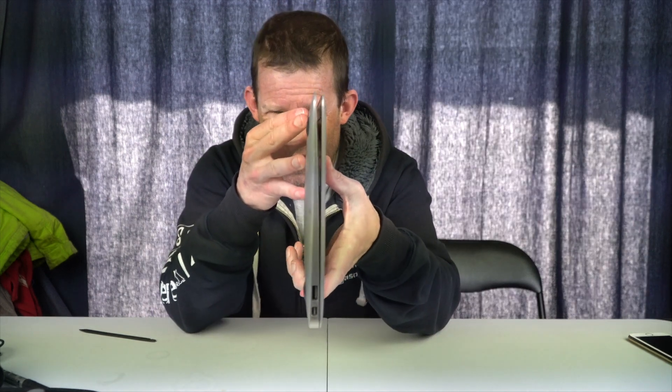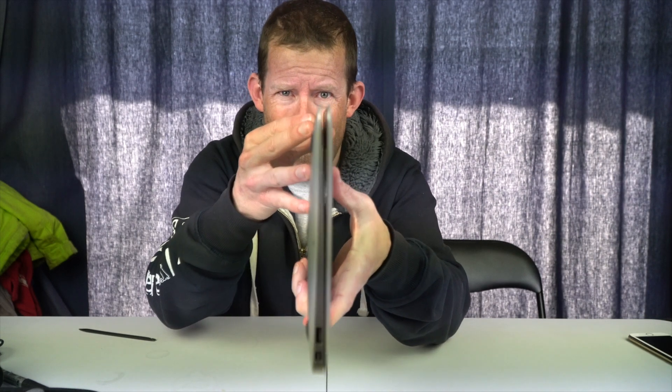And they think it's the trackpad. Then when I picked it up, I suddenly noticed the laptop felt really strange. I went to try and close it — that is as closed as I can actually make it without forcing it. I don't want to force it. And basically what's happening is the lithium-ion battery in there is ballooning.